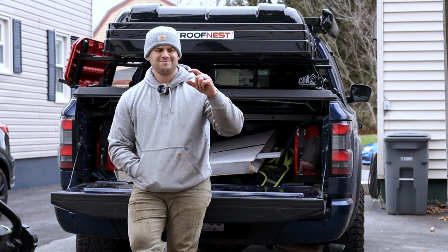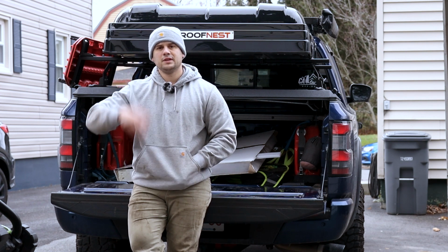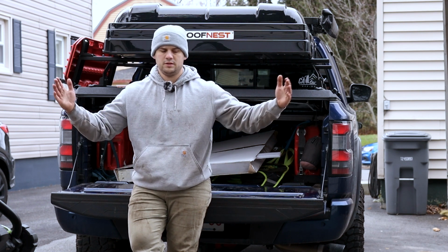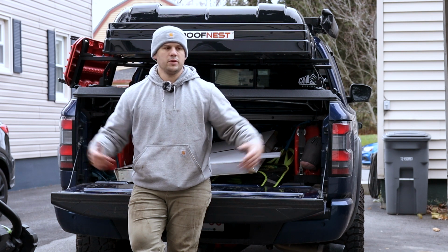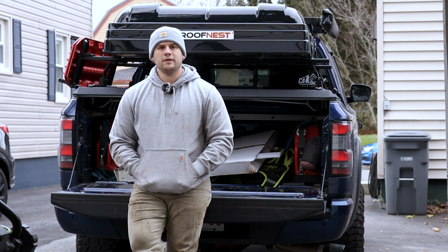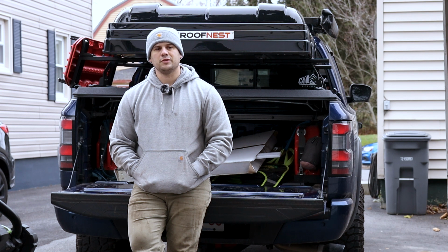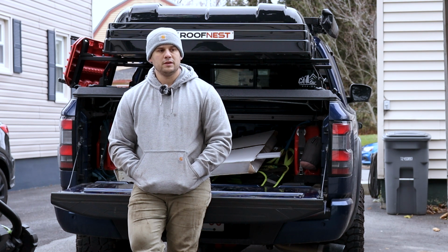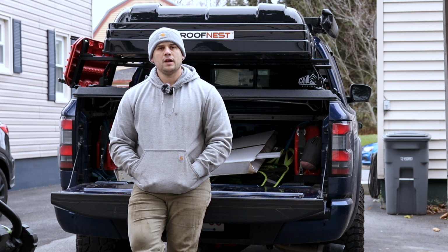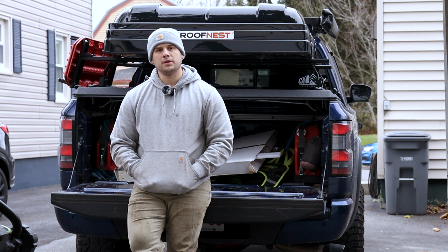You probably got 1.5 to 2 inches above the frame, and it's not much, because when you think about it, from the engine skid to the transfer skid, it's probably a void that large in length, and in width it's probably about as wide as my arms right here. But yeah, it's just a big open area. I feel like from the factory they should have put something there, because that transmission pan is plastic. I'm not sure about the previous ones, but this one's that weird ribbed plastic. Sure, it's probably pretty durable, but getting smashed by a rock or a tree stump durable, probably not. So I opted with the Z1 transmission skid plate, like I said.